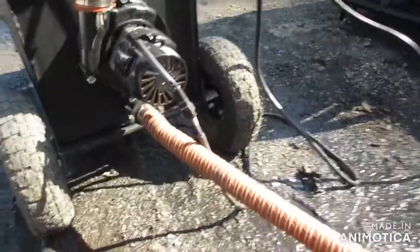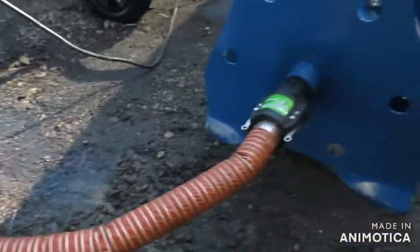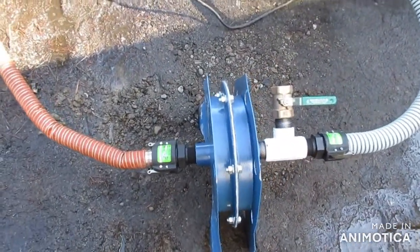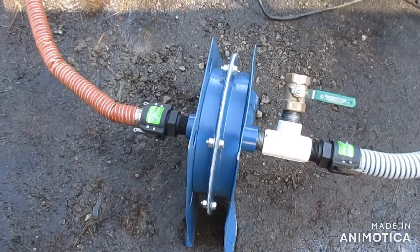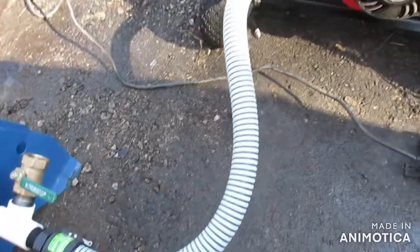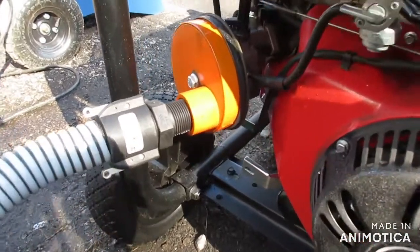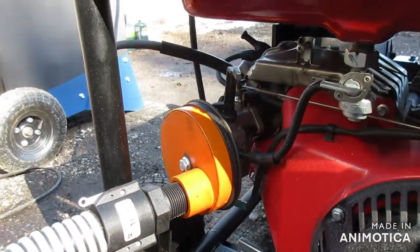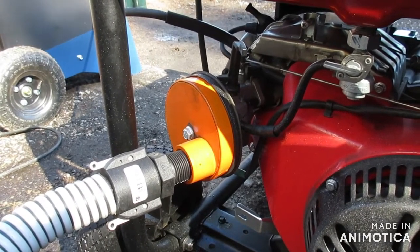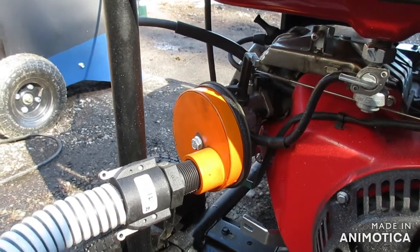There's my gas output port with a quick-connect hose leading to the pancake filter. This is a single plane — you can pretty much stack these indefinitely, and this seems to work pretty well. Then there's the mixer valve, and the hose going to the engine adapter. There is a tutorial on the forum showing you how to adapt this to the Predator engines, the Honda, single-cylinder engines, and all the clones. It basically just bolts in place of the air cleaners — it's pretty straightforward.